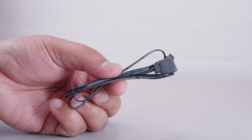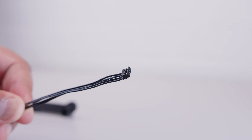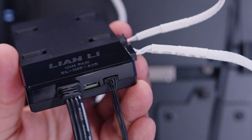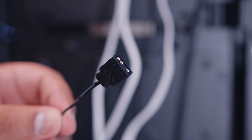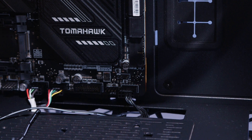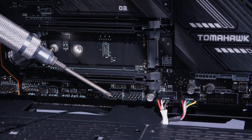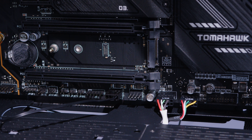Locate the pass-through PWM and pass-through RGB cable — this is optional. Plug this end into the connector on the bottom of the RGB controller. Next, plug in the 3-pin 5-volt addressable RGB cable into a 3-pin 5-volt addressable RGB header on your motherboard. We've also got the PWM fan cable for fan speed control — locate another PWM fan header on your motherboard and plug that cable in.